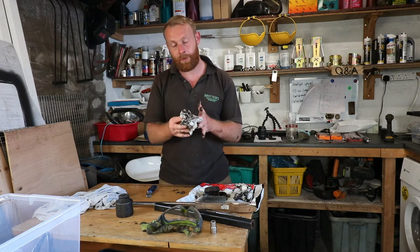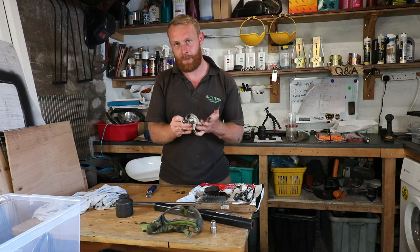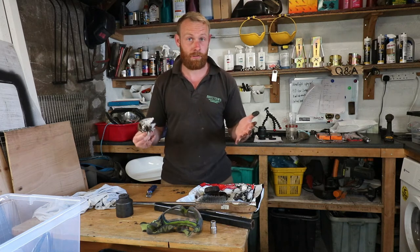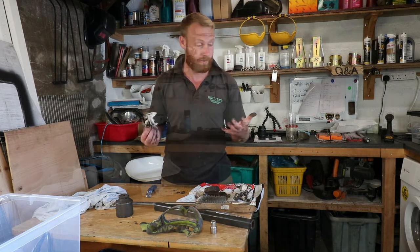They have been on the car for about 5 years, and I didn't check them as often as I should have done. They should really be checked every year, I'd say. Checked every year, re-greased, readjusted, and if there's any signs of corrosion, replace.